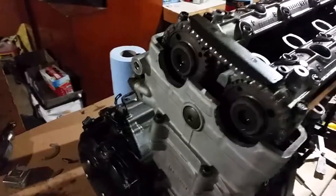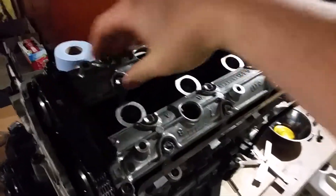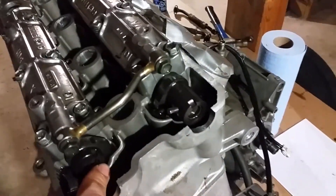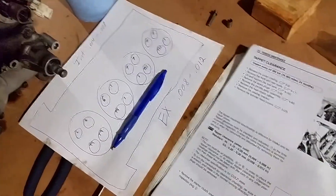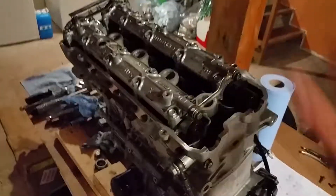But if you have to make an adjustment, that's when it gets a little trickier. First of all, you'll have to remove your cam chain tensioner, loosen off the cam chain, then remove your cam holders. On this one it's two pieces — one single holder for exhaust and one for intake. A lot of them have just one complete holder for all of them. Anyway, they have to come off, the cams have to come out, and then you get at the tappets themselves — often called buckets — shim-under-bucket valves. Since we've got some very tight valves, we've got to go on to adjusting them.